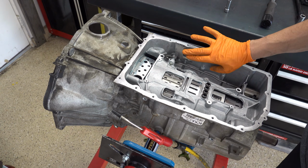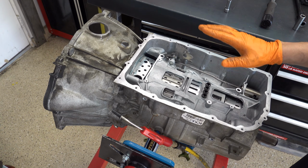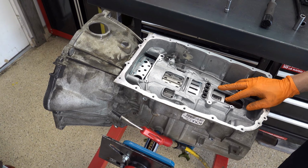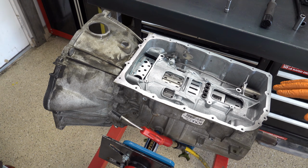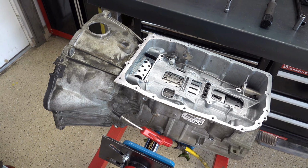All right, so we talked about the parking rod deal. Went over pump installation, did air checks, so now we're ready to bolt the whole, what I'll call, control body complex, valve body, TECM, IMS, speed sensors, and harness onto the case using the 6 starfish bolts. So first thing you want to do is put your new seals onto your valve body, onto the upper valve body.